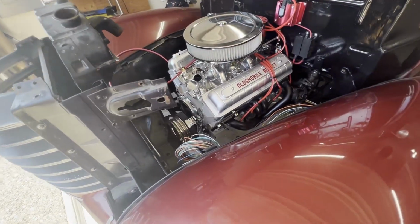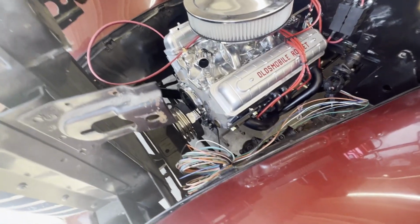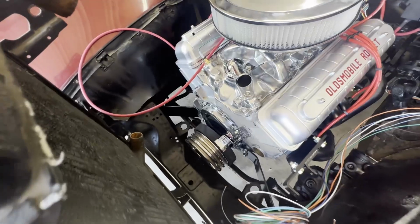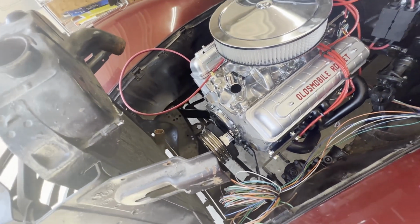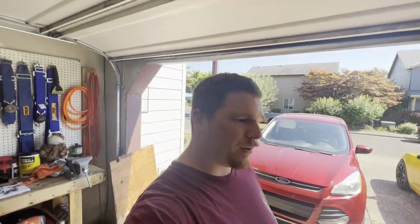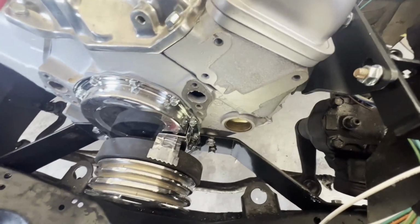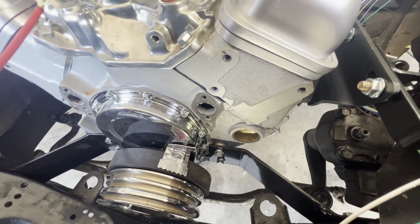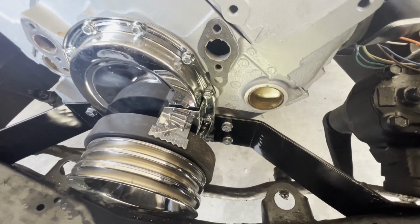So from the previous segment, I'm sure you saw that the alternator was on the driver's side, and there's no water pump. Well, converting it over to a long water pump gave me a lot more options for bracketry to fit the power steering and the alternator together, because we are using those bottom bolts for a motor mount. Power steering, factory stuff, or just brackets that are available, they all want you to use those lower bolts. Can't use them, man.